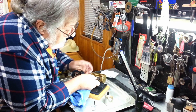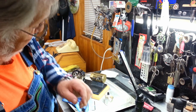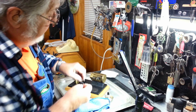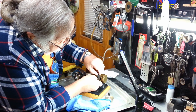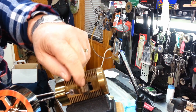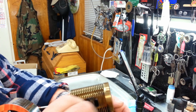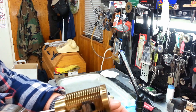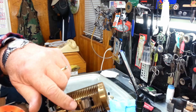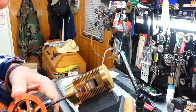This little thing right here — you can take this out. This is actually the valve that slides back and forth on that thing. You've got to have that thing pretty well timed. If you don't, she'll kind of be putting. And there's a certain amount of pressure you've got to have on this thing too — where it'll kick the valve out. You actually bend this thing in or out to adjust your valve. And then you bend it in to keep pressure on it. It's got to have a certain amount of pressure. If you ain't got pressure on it, once it fires it'll push it off. It's kind of crucial — you've got to play with it, figure out how to bend this thing. To get them running you've got to have that just flush with that intake right there. I believe we got it pretty close.